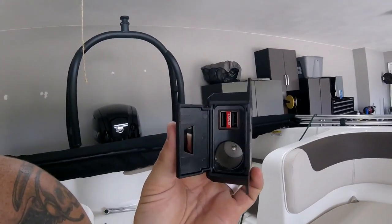I have the garage doors open. Today we're going to be looking at a 12-volt outlet install. I originally installed the 12-volt that I got from Lowe's — I thought it would be good quality. It's got a fuse inside, so I figured I was protected. It has a 12-volt and two USBs for charging cell phones, but the main reason for the 12-volt is for blowing up the tube. The problem is it has super cheap, thin wire so it can't hold the load. I took it on the lake, actually needed to blow the tube up, and it didn't work — it would run for maybe five seconds and quit. I'm sure I was overloading something, so I went ahead and uninstalled it.